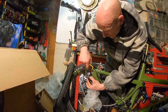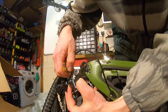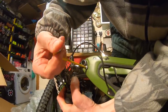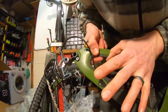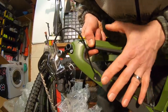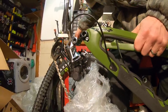Nice to see a proper-sized replaceable derailleur hanger bolt, because all too often they're absolutely tiny and the hangers start to work loose really quickly. The bike comes with really neat little cable port covers, so it'll set up for wireless or single ring. Interestingly, despite the fact that Pivot always worked really closely with Shimano, there's no provision for Di2 — which suggests the next Shimano electric setup coming along is wireless as well.